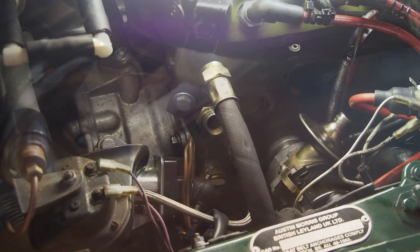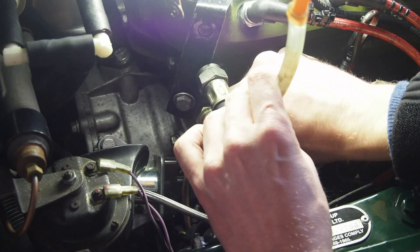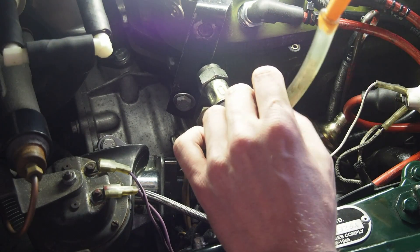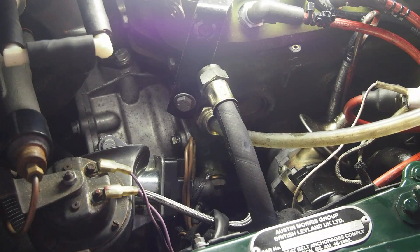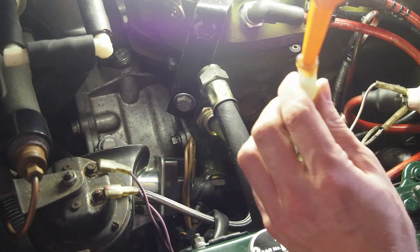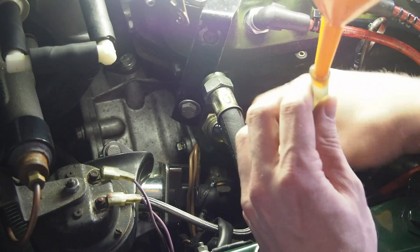After this I like to just fill both the oil hose as well as the galleries with oil as far as I can. So just another gulp of oil until it comes out there, and then the same thing is done with the hose.